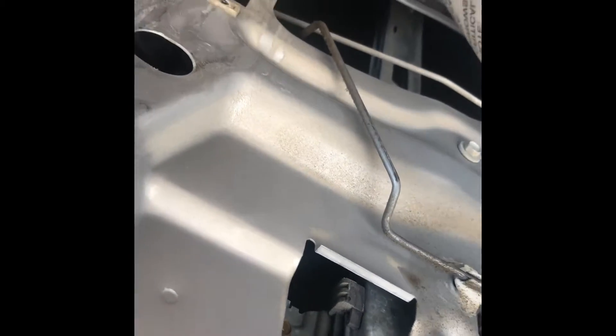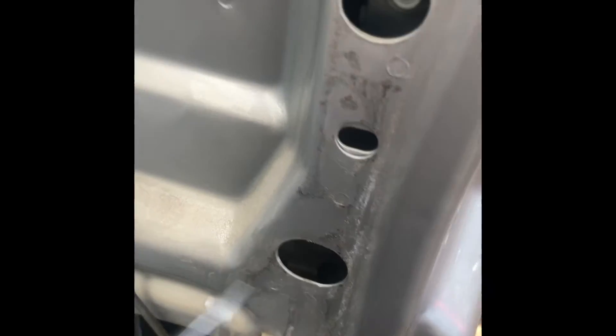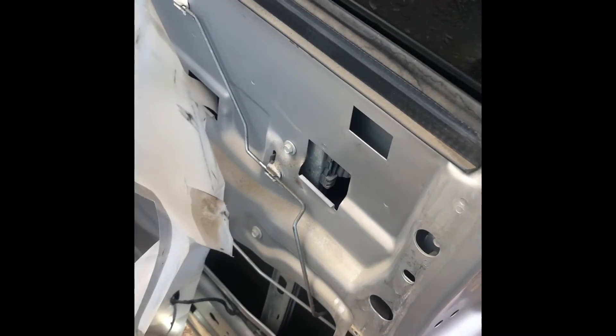Down here — I don't know if you guys can see it — but there's one bolt in there, one hidden right here behind this mechanism. It's a pain to get out, so what you want to do is stick your hand back here behind the glass, just like I am right now. You see my fingers? That's where you want that little ratchet wrench to get the last bolt out. Then there's this one right here, which I'll pull out — I'm using a flathead, it's fastest for me. And then the third one is in there. So now that we've counted one, two, and then the third one back here, you want to go ahead and pull all three of those 10 millimeter bolts out.